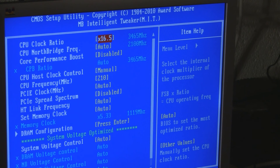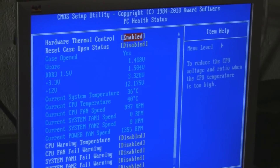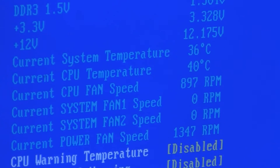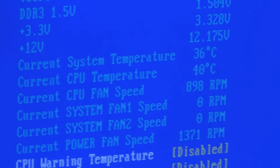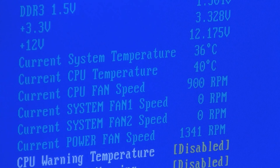I could try to take it up higher, but right now I want to look at the temperature. Before we had it at 30 degrees. With this small overclock it's at 40 degrees Celsius. But I'm going to be running all six cores at near 100% all the time with this thing, so I don't want to go too high. I think that's all I'm going to do. There's still some overhead in terms of temperature and voltage — if I got on the internet and looked at some settings, I could probably get this thing a lot higher, maybe even close to four. But that's not really what I'm trying to do here. What I wanted was a little more speed and a lot less noise, and I've succeeded in that.